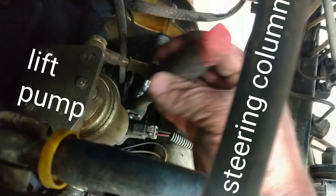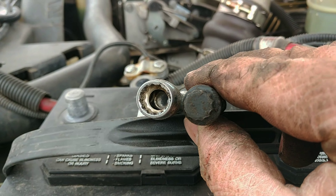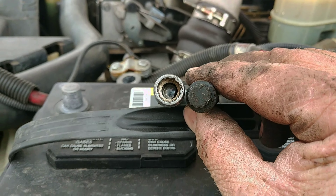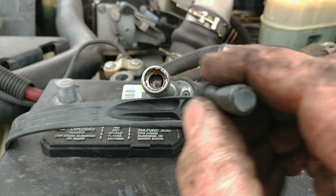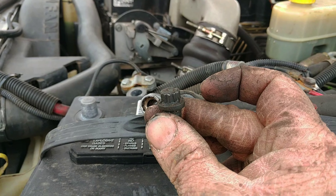While I'm down here, 10 millimeter is what I use, but it's a 12-sided — hopefully you can see that. It's not a six-sided, it's a 12-sided wrench and that fits in it. Here's that bolt so you can see — it corresponds with this 10 millimeter. We got to get the one that has more than six sides on it and it fits perfectly, nice and snug. Standard won't work, I tried that — it fits between sizes: 7/16 is too big, 3/8 is too small.